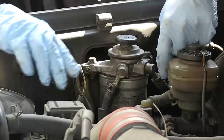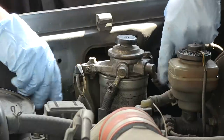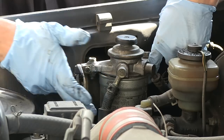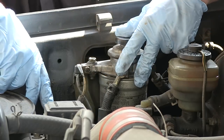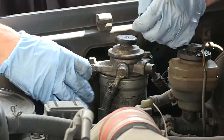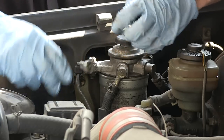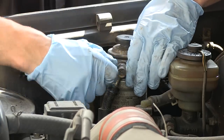There are a couple different ways you can do this. You can either take off these two fuel lines, take off the bracket mounts, bring it to your bench, use a filter wrench and pop it off, or you can leave it on the truck if it's accessible — undo this little sedimenter sender unit. This is what I'm doing.